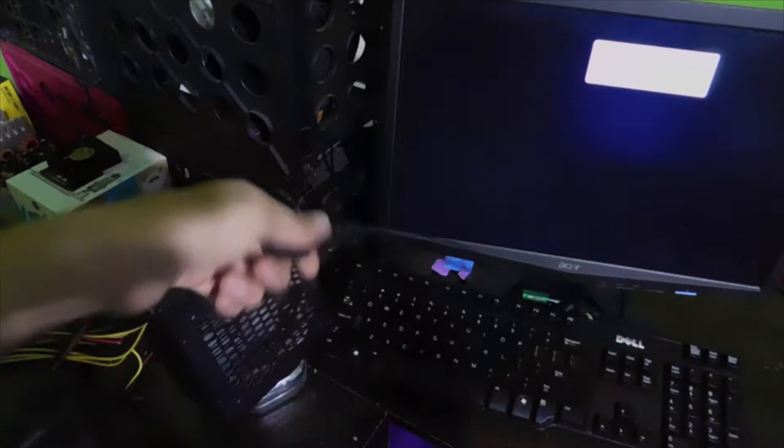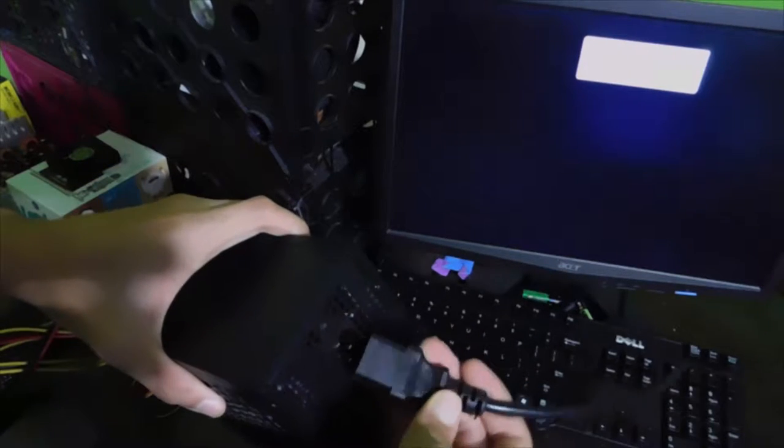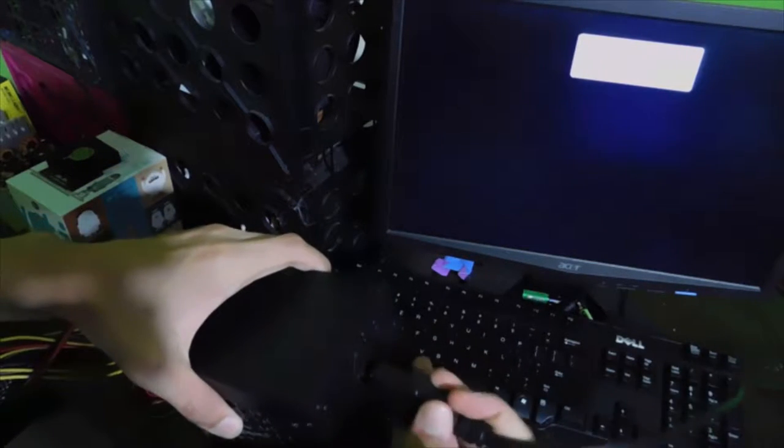Okay, so I have no idea why it's not turning on. I unplugged a few more plugs from the old power supply, but that power supply isn't getting any power, and the things that were plugged into it, I already had disconnected from the motherboard. So I'm guessing it's just that SATA cable was broken because of that chomp there. So I switched the SATA cable from another computer I got, and let's plug this back in, see if it works now. Hopefully it'll work.